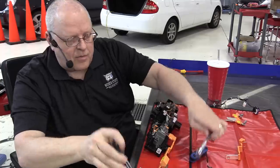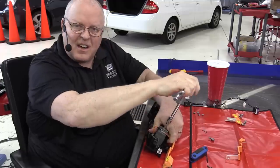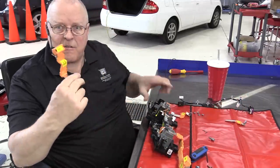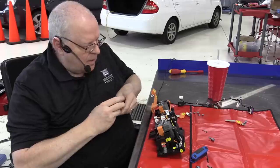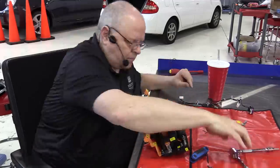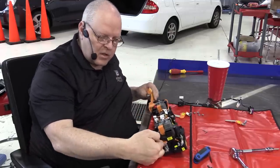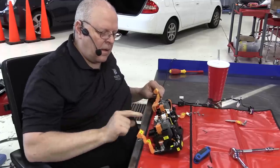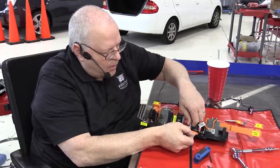Now I will have to take this back off before we put it back on the battery, but I just want to show you where everything connects. I think it'll help you understand how it works. All right, then we have our overall battery negative terminal over here on the other side that connects through the negative contactor, and it sits right here. So these two are the inputs. We have our positive and our negative. The negative goes through the current sensor that goes to our negative contactor. That then, once that negative contactor closes, we have a negative terminal output right here